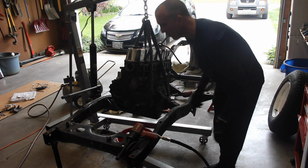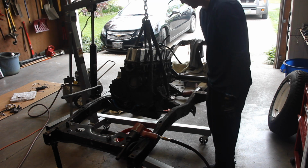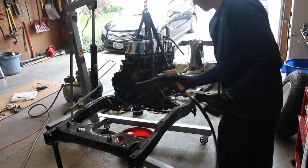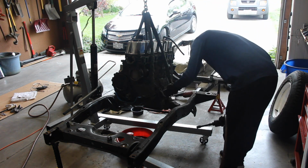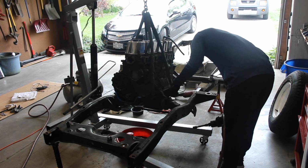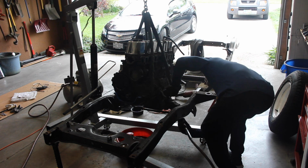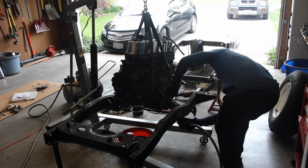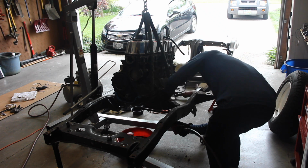Okay, looking at these 3 bolts, they're all the same length, so I don't know if that one just happened to be an obscure bolt or not. Okay, let's hoist it up. Alright, so I'm going to give myself hopefully a little bit more room. I'm going to take off the mounting bracket. This is also 9/16. So that way maybe I can swing it over. Here's your engine ground strap, or at least it is for this one.